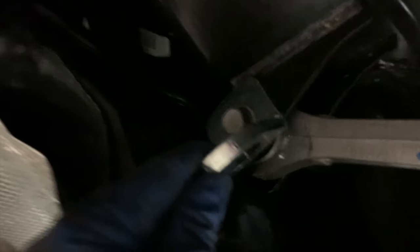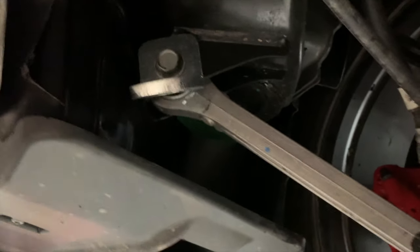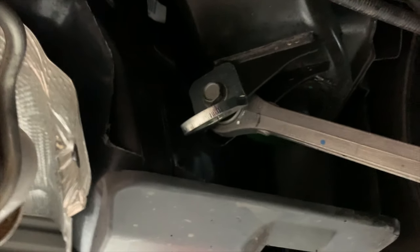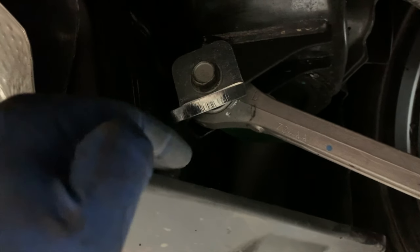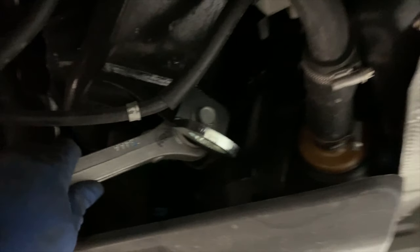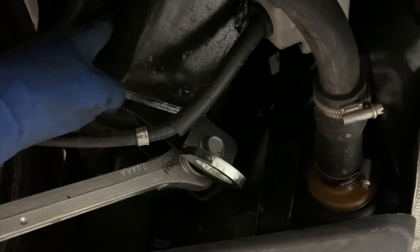Petty's Garage makes these really nice tie-down hooks. This one bolts onto the rear lower control arm. I have mine at an angle — I think on the ground it'll be a little easier to hook on. The instructions say to mount it flat and straight down, but I think it's just personal preference. Same thing on the other side. This gives a nice spot directly to the rear subframe. It's not going to have any give or flex or put unwanted stress on anything — definitely a good spot to ratchet down on in the back for towing.